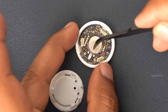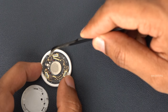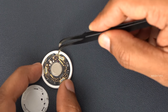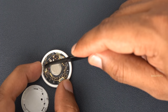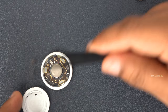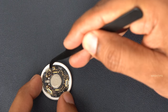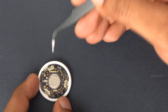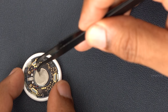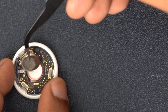Here is the case that is almost coming out, and here is the AirTag — you've got it. This tiny part is the speaker and this is the battery contact. Try to insert the screwdriver around here — once you have the battery contact located, it's better to try on this side or this side to take off that plate. Here is the plastic plate we took out — light gray color. Here is the speaker, and you can see the coil that goes into the speaker for making the noise. If you don't want to break the coil, use your tweezers and try to take it off from this side — do not touch the coil. Leave a space there and simply take off the speaker.